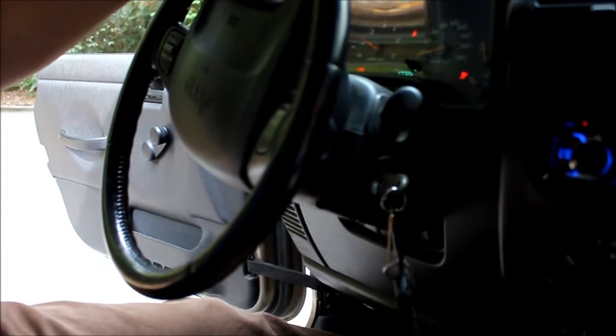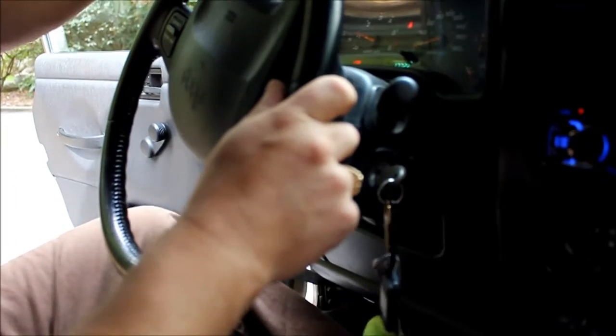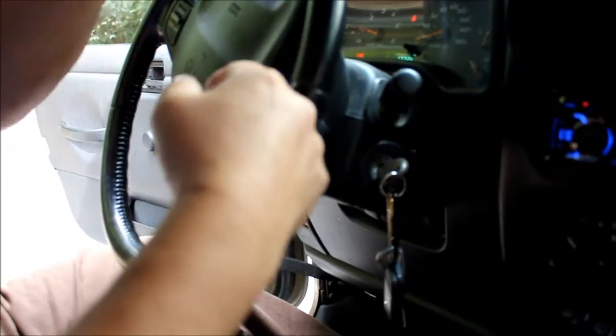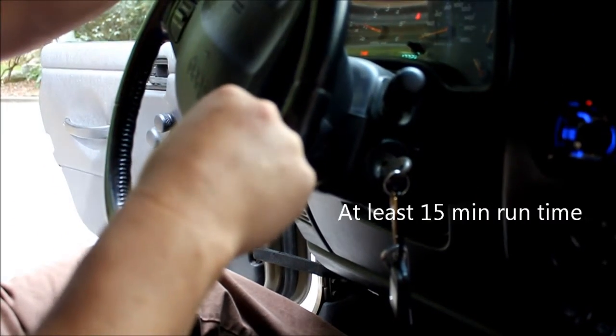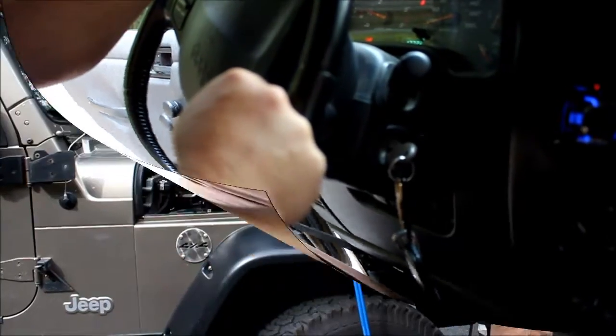And I think we want to let it run for a little while to help charge up that battery that was on the dead RV. We want to do this so we can start putting a charge back into that other battery before we try starting the bus. Because this is obviously a smaller battery than the battery that we're charging. But we are getting amperage charging that other battery.